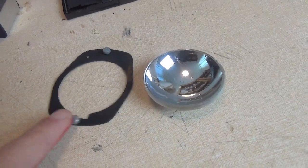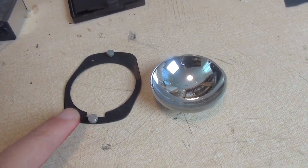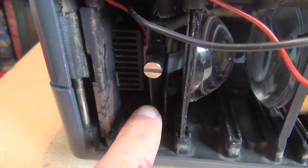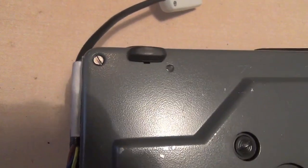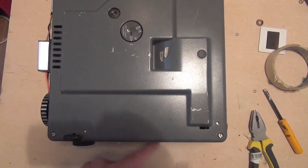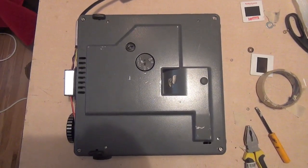I've removed the reflector and that was its mount, because that's not needed. There's a panel-type LED display chip thing, so there's no possibility of using a reflector. We have in here a heat sink to which the little LED unit is attached. If the projector does need to be taken apart, there are just four screws, one in each corner, and then as you lift the bottom up, the doors and things will fall off, so just check that you understand where the other door and other pieces fit before you actually take it apart.